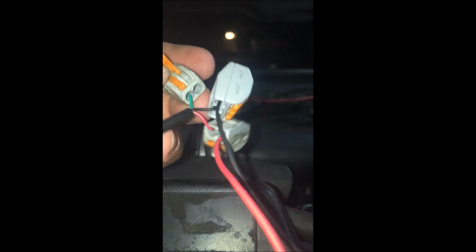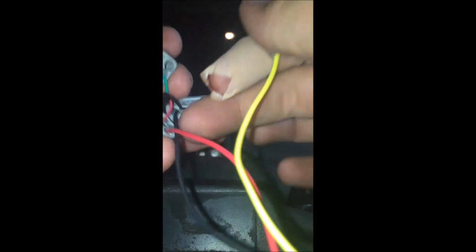Again, we got to send black wire from the Edge system to ground that out. Send it a reference voltage, and then the green wire on the pressure sensor is going to be your signal back from the sensor. It'll actually be a 0.5 to 4.5 volt signal, and that'll be green on the sensor, as you can see there, but it's actually yellow going into the Edge system.